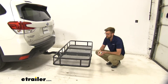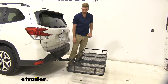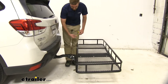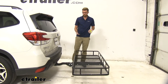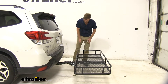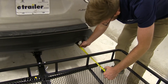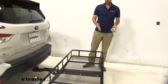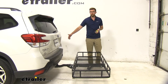If you were on a pretty steep incline you may have some issues with it. But what I like about it is I can run my straps and easily access them to hook here — there's plenty of space to work, and that's going to be a measurement of about 13 and a half inches of clearance. Another thing that's important is how much space we have between our exhaust. We've tested the eTrailer aluminum cargo carrier — that's a really good carrier, it sits closer and it's lighter, but you lose the tilting aspects, and with that one the exhaust is really close. This one sticks further out, at about 19 inches, which is quite a bit further out than a lot of them. That means it's going to have better capacity for carrying heat sensitive items like the cargo carrier bags that are popular with these.